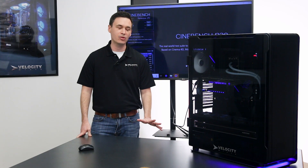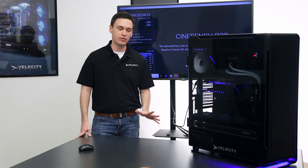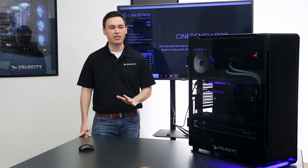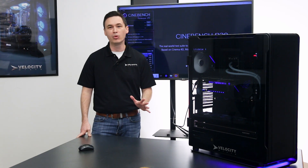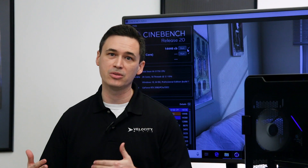You can take a look at some of the hardware here really quick. We've got the processor overclocked — it's a 28-core processor — overclocked to 4.2 across all cores and 4.6 across two of the cores. One really important distinction about overclocking: you may see some reviews out there with this chip overclocked at 4.6 or 4.7, but they have the AVX offset down to 3.1, which is stock. We have the AVX at 4.0, so in terms of real-world performance you're going to see much, much better numbers — nice and stable at 4.2 and 4.0.